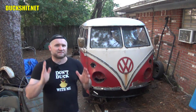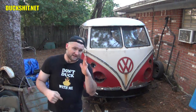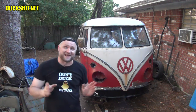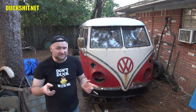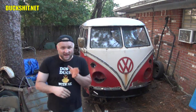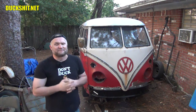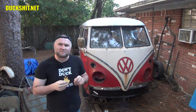IRS suspension — the wheels pretty much just go straight up and down. They will camber in just a little bit, and that's natural. You do want a wheel to slightly camber in when you're in that turn on the outside wheel, so that it digs into the pavement versus the swing axle behavior. The camber is actually designed to help steer the vehicle. The rear wheels will steer the vehicle when you get into it because that wheel will actually come up and camber. And your alignment will come in too — the alignment of the wheels will come in slightly when your suspension is compressed. So a lot happens in those rear wheels that a lot of people don't seem to think about. Swing axle is definitely not for me.